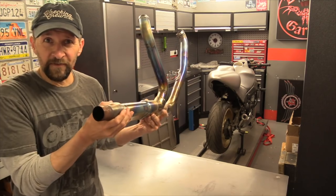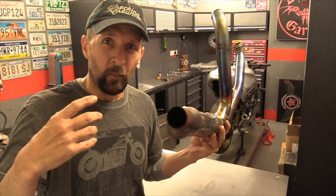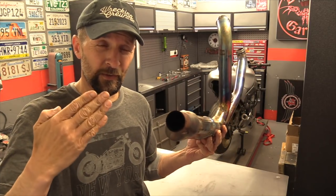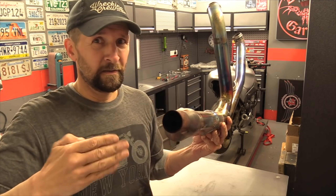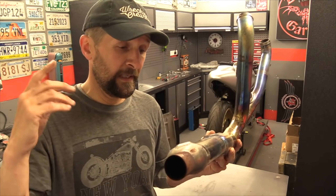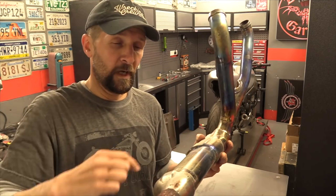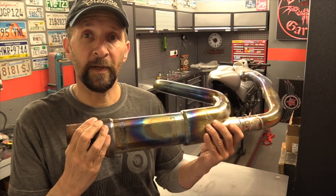Some people I've seen on the net just use a big horrible wall drill or a masonry drill, or even a wood-cutting paddle bit — just going in there and tearing big holes in it, which is just horrible. There's only one way to do it properly: cut a hole in this, pull it all out, then weld the hole back up. So let's get the disc cutter and I'll show you where the best place to put the hole is.